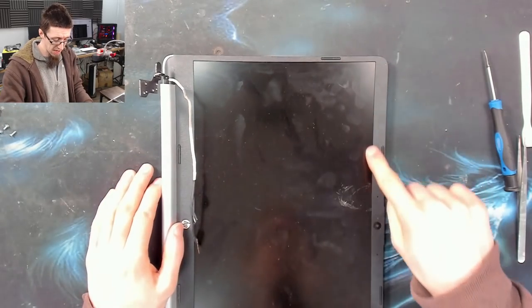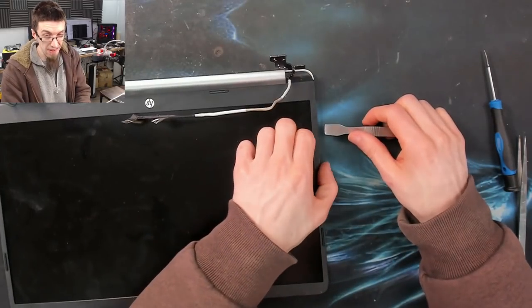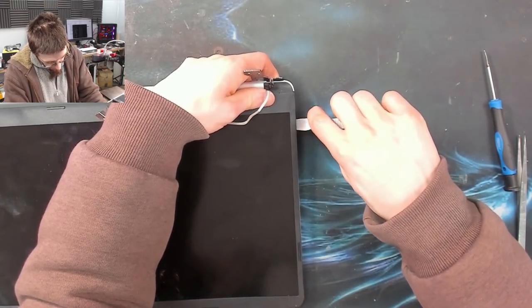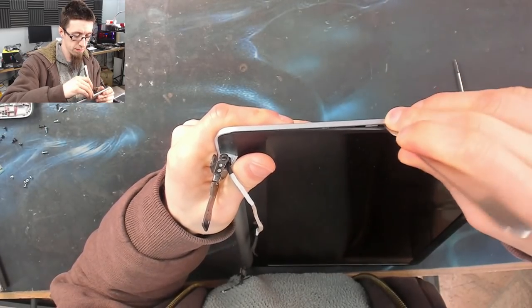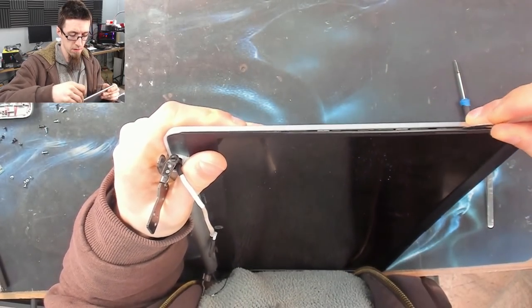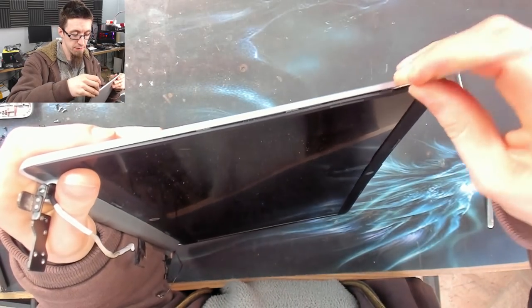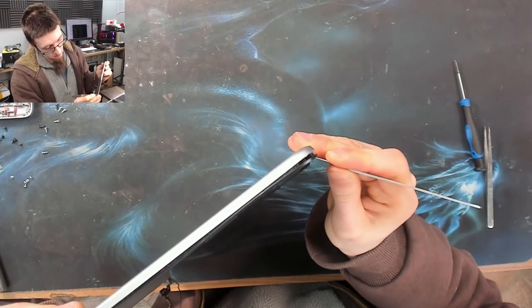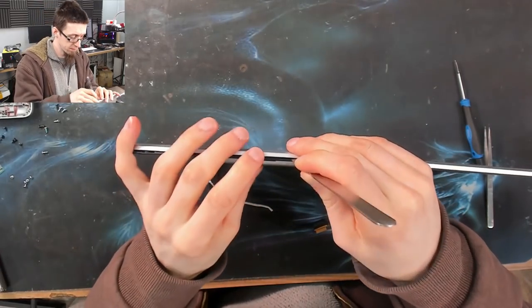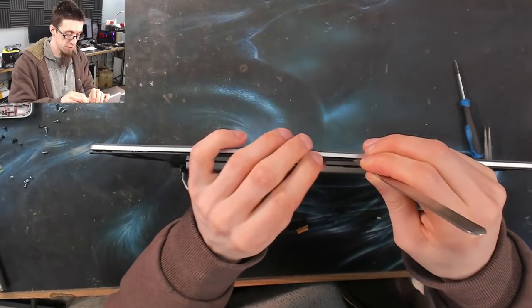However on HPs they often have double-sided tape around the insides holding the bezel against the screen, and that is going to give you a lot of trouble. So I'll release those clips and then work on that double-sided tape. I'm going to take my prying tool and just gently ease into the gap here, moving along and finding those clips. I'm being a little bit careful around the webcam area just so I don't dig in and damage it.